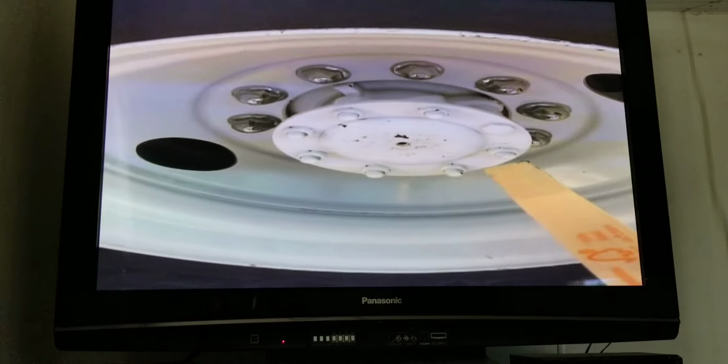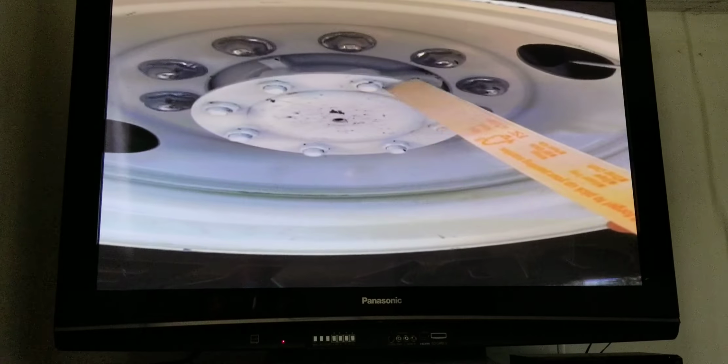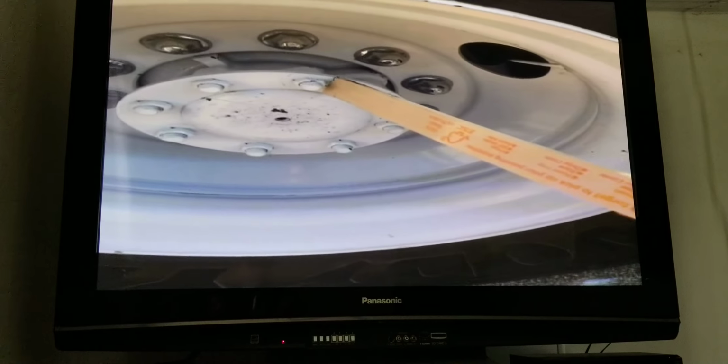I have my axle seal. It is properly mounted, properly greased, with no loose or missing bolts, or bends, cracks, or any illegal welds on it. I have my reflectors. All my reflectors are present and visible, clear and red in color. The top of my flatbed is free of debris and trash. There's no loose or missing bolts. There's no bends, cracks, or any illegal welds.